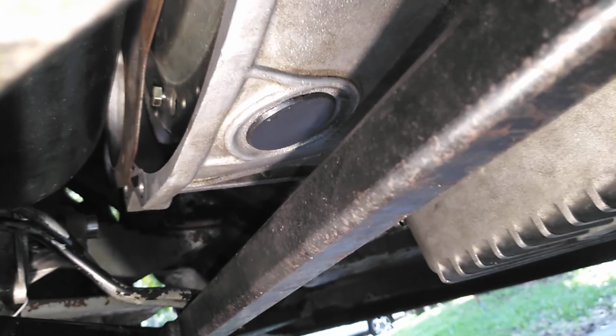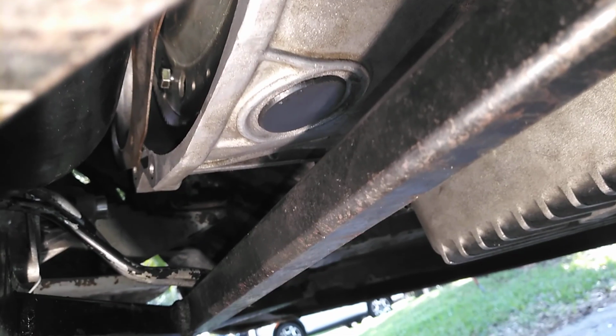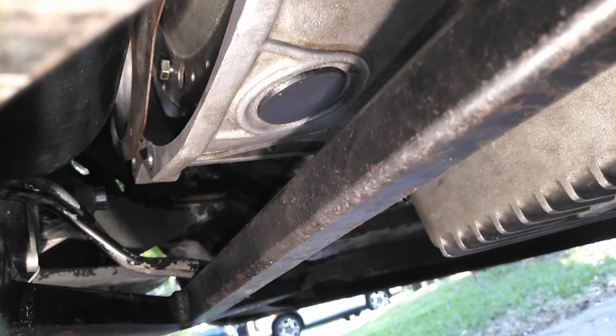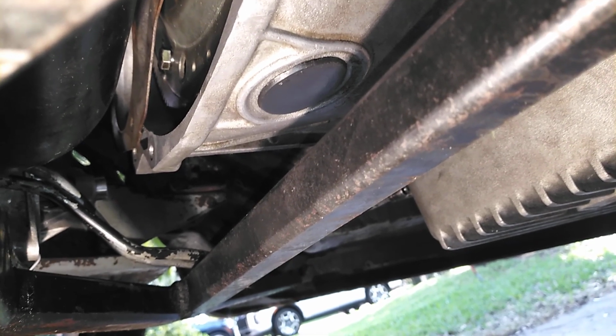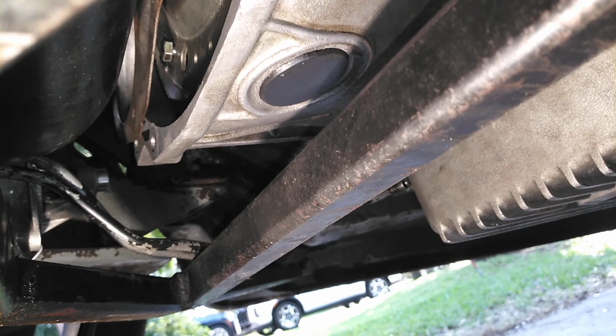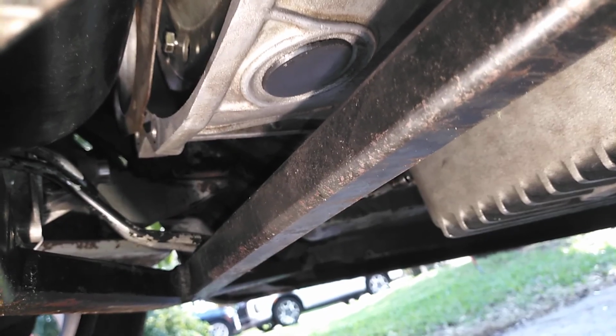And then you're going to line up the torque converter bolts where the light is pictured above. I don't know if you can see all that clearly. Well, I have the torque converter bolts already. I hand threaded all 4 of them in. The gold ones there, they're grade 8. And I hand threaded them all in there. They're automotive grade bolts. I got the exact size before I put the converter in. I threaded them in. Everything was good to go.